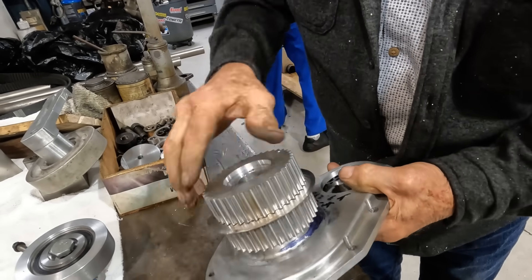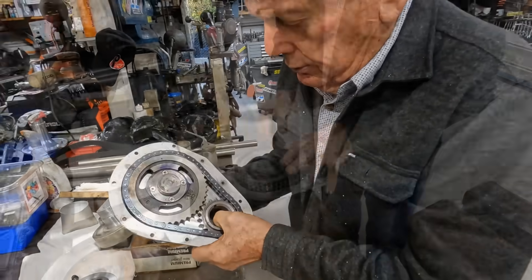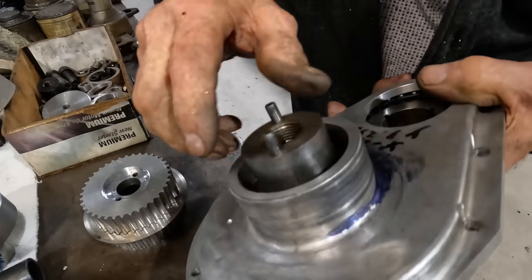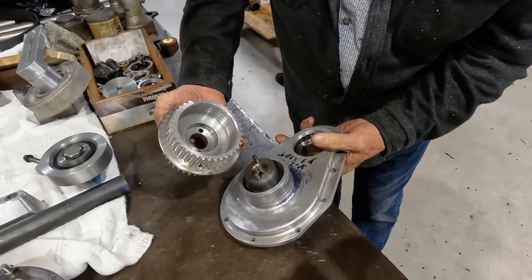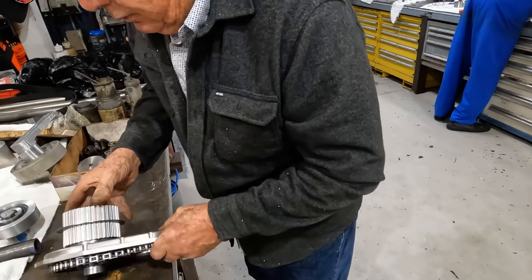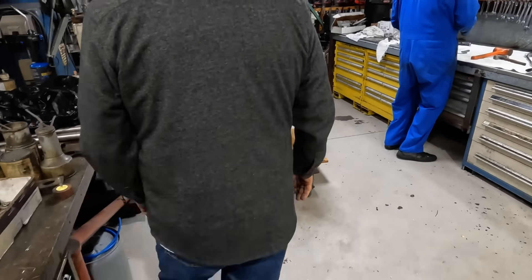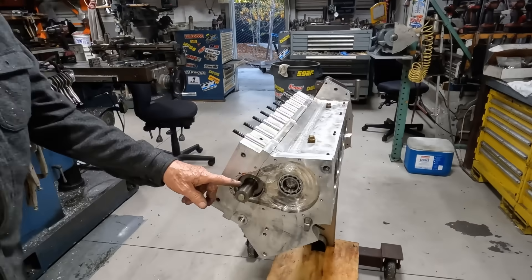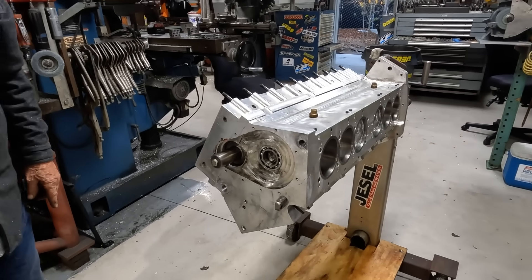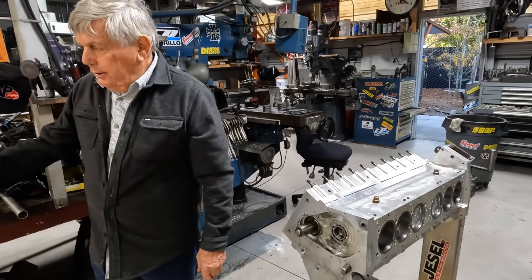This turns the two cams up top, so it's a little bit like a Chevrolet. Then we put the extension on it — we've got a ball bearing in there and an oil seal. Then we've got the idlers on either side. Kevin's putting the last one in — this is a symbolic moment. The milled section goes right in here. It's pretty cool-looking timing chain and all that stuff.